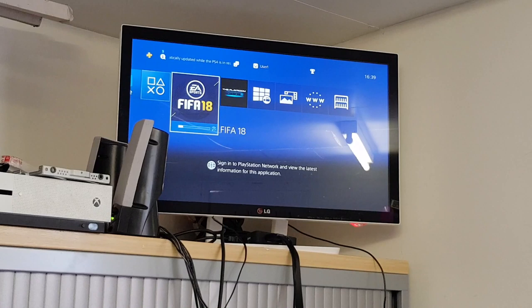As you can see, that's now working. And also the trace damage and the crappy soldering on the hard disk drive SATA header would have meant that probably wouldn't have worked too well either. There's a reason it's here in this pile, because he goes through them and he tries to get them working. So evidently this one hasn't been working. And when he's taken it apart and he's seen the damage, that's why it's ended up in that pile that I've got here. So like I said, they don't all come here. If he goes through them and if he gets them working, then obviously we don't get them. We only get the ones he can't get working. So this one obviously had a few deeper underlying issues, which we now appear to have resolved.